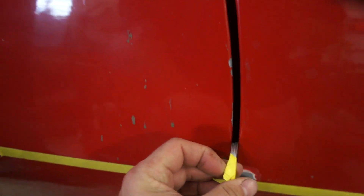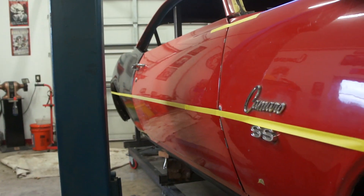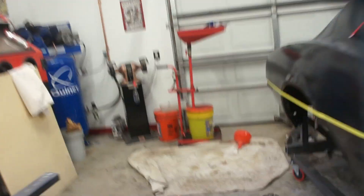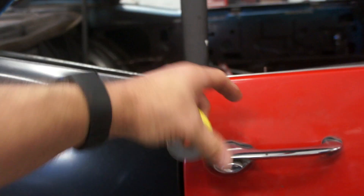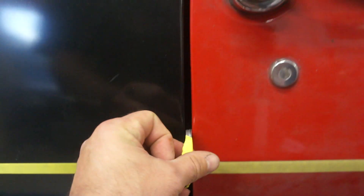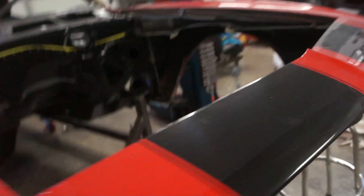These gaps are actually pretty good. Now the fender is just sitting on there, so it needs to be adjusted out a little bit farther. But you can see I got my body lines the way I wanted them. My gaps up here are a little tight — I'll fix that. When the door gets twisted the way it's supposed to and goes in down here, that'll change things. This is already pretty much 3/16ths all the way up, so hopefully I won't have to do any cutting on this panel for the gaps.